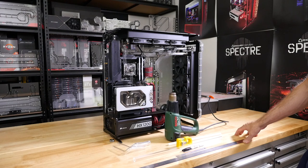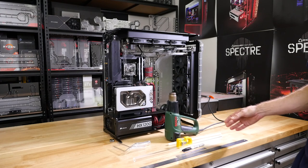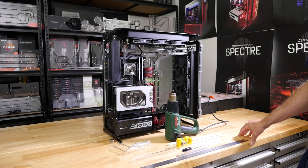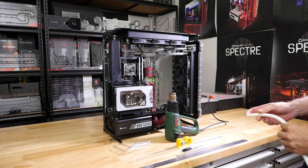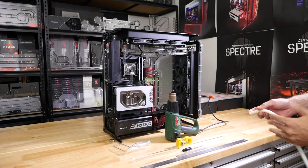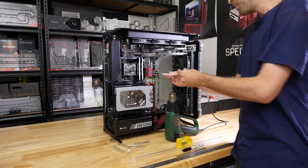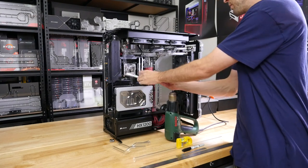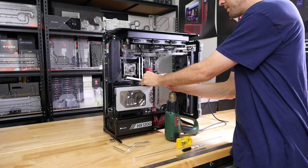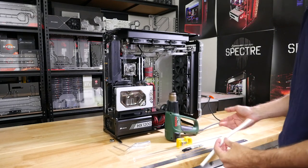Now, how much tube do you need? I've obviously had a lot of experience and I still redo tubes two or three times before I'm happy with them. So I would allow for about three times the average on all of your tubes. How I figure out my lengths — there are tube bending jigs and things, but I do all of it freehand because I like the freedom it gives me to get the exact shapes I want. I prefer to just do it completely by hand. You roughly get it with the silicone insert, roughly follow the route you want the tube to follow, then measure that out on the tube and add a little bit more — 30 millimetres or something.